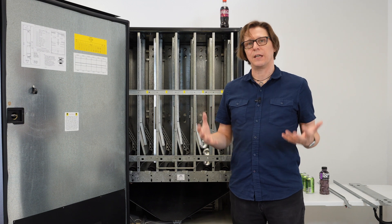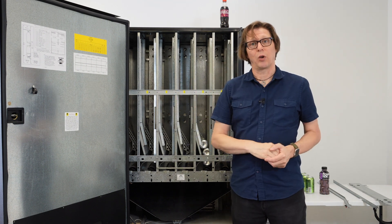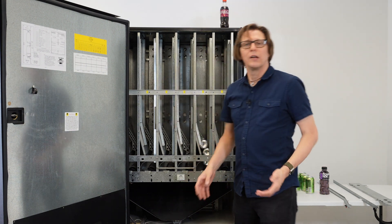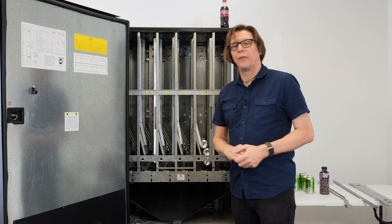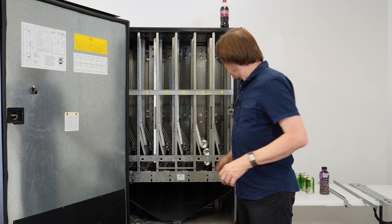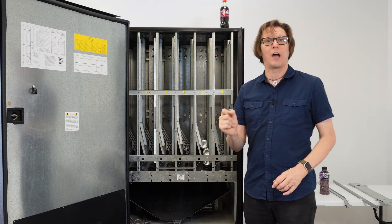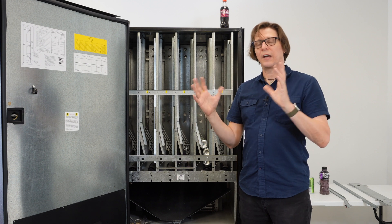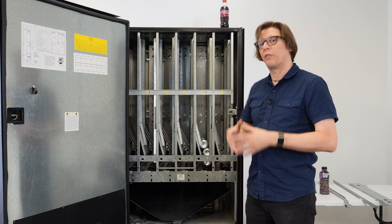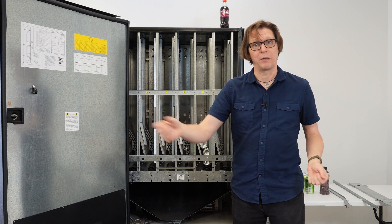There's a setting on this machine called SDEP — Set Depth. We are setting the depth, telling the computer board the depth of each individual column. What we're actually adjusting is the shut-off timing of when the products drop on the delivery chute. On our Merlin 4 drink vending machine, there is a drop sensor on the chute. When the products drop onto that chute, the computer board knows the product has been vended and tells the motor to stop. There is approximately a 15-second window — when the motor starts rotating, something has to drop on that chute within that window, or it will mark that selection as sold out.